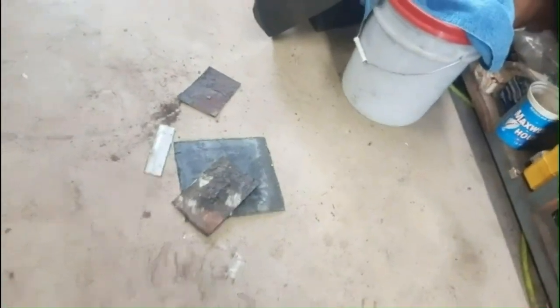And then just working on patching the box up here. I've been cutting little pieces of metal from scrapped leftover stuff and a good piece of old metal, taking the grinder to them, cleaning them up, and then welding them on here. Just finished this one here, and then I think I'll probably do that next.